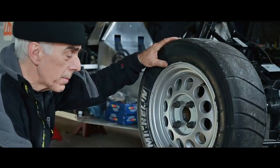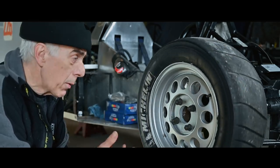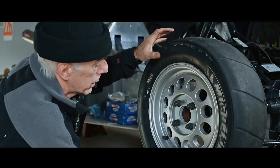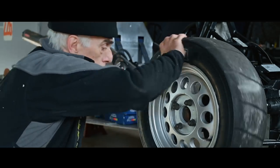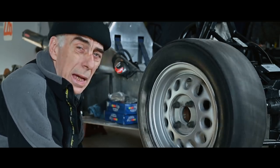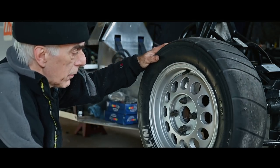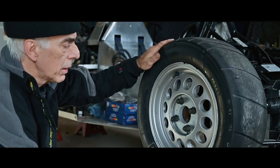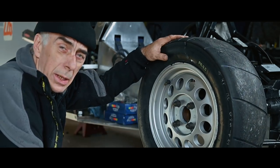The wheel should be spinning around a spindle or a wheel bearing, and this car has a pretty good bearing on it. It's not loose, it has no play, and when I rotate the wheel it doesn't make any annoying or grinding sounds. If you rotate it by hand you can feel on the tire if there's a worn-out bearing — you could actually hear it and feel it.